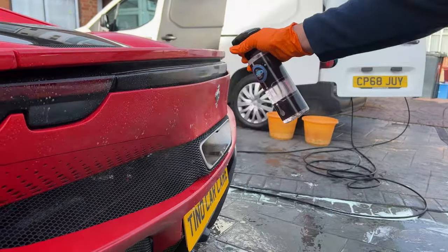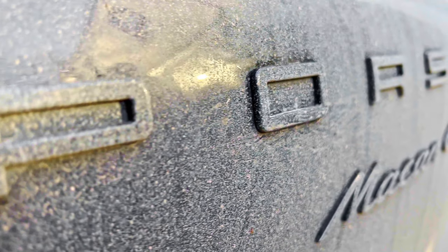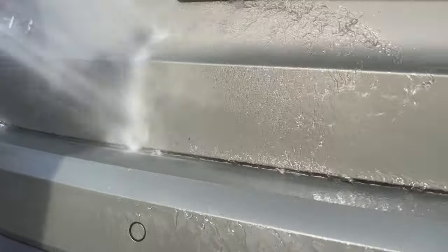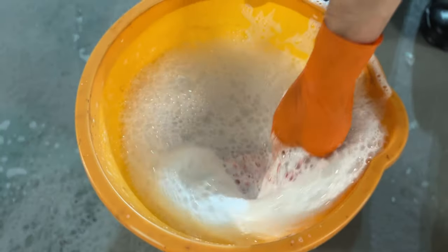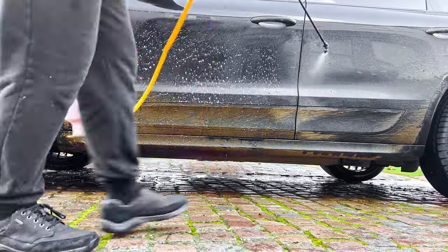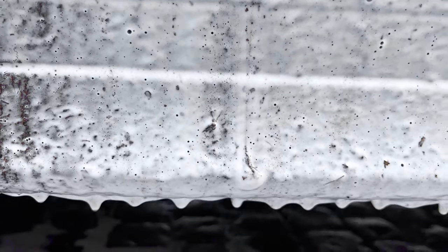The pre-wash is one of the most important and underrated steps of the wash, and one of the main ways to avoid swirl marks. As cars can usually contain a thick and hard film of dirt, road grime and contamination, and pressure washing alone usually fails to remove it. So if you miss the pre-wash stage and go straight to the hand wash, you are essentially scraping that dirt around the car, causing scratches and swirls. This is why you need to perform a pre-wash — this step is designed to break down and loosen the dirt, allowing the pressure washer to blast it off with ease.